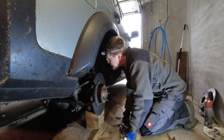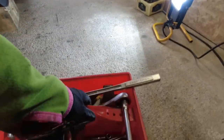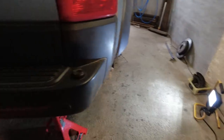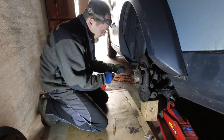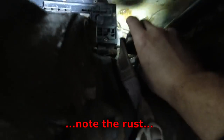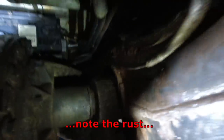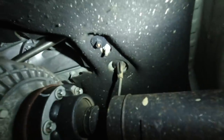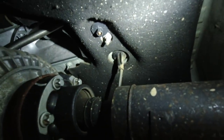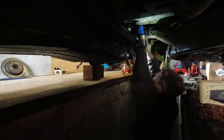Now we've got to do this on the other side. This is the second side out, and this cable is also still moving okay. Now we've got to take out the emergency release cable — this one here — which is clipped a couple of times and runs along here above the driveshaft. That's why the heat shield needed to come out, and it goes up here into the chassis. Now I've got the emergency release cable out.